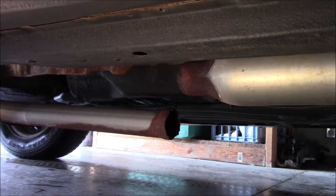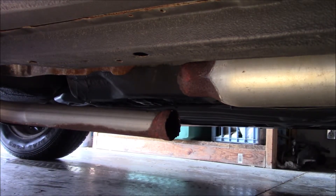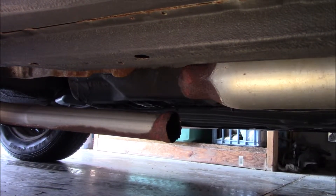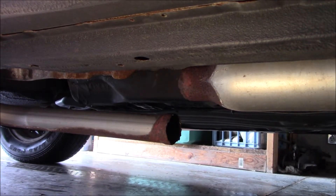What we have here today is a Honda Civic. Right after the resonator, the rest of the exhaust pipe rusted off and broke off. We'll just put a coupling on there with clamps and make it a little quieter.